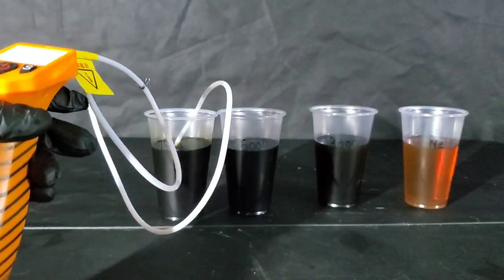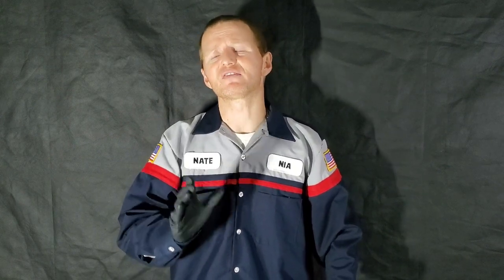I'm not sure what's happened here. That's not the most accurate way to measure the motor oil because there's a significant difference between samples. Using this optical sensor — passing light through the oil and seeing how much light made it through — going by the darkness or color of the oil is not a good way to tell quality. The additive package is actually doing its job, and after maybe 1,000 miles the oil could be pretty dark. So it's not going to be an accurate way to judge anything. The car had 1,000 miles on the motor oil and it's already saying the oil is bad — not accurate.